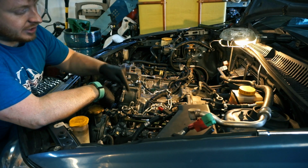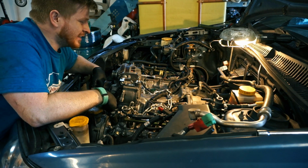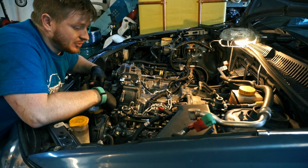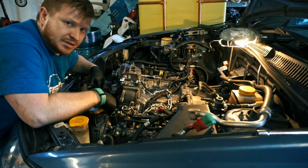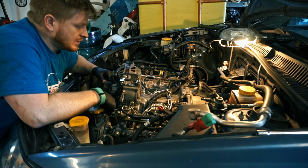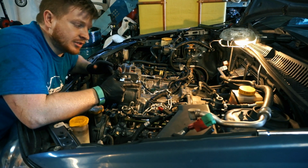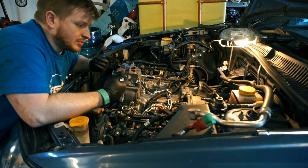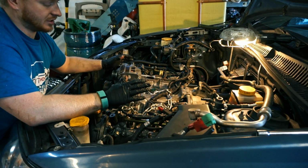These are such good engines, especially the R. VTEC, yo. Variable valve timing is considerably more awesome than a non-variable valve timing H6, even though they're both pretty rad. So now it's just buttoning up the last bitsies and getting the flex plate torqued to the torque converter, getting the engine torqued to the bell housing, getting my starter on, motor mounts bolted into the cross member, exhaust manifold on, intake manifold on, power steering pump.